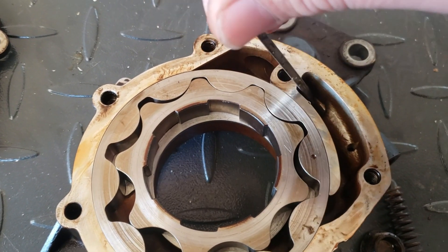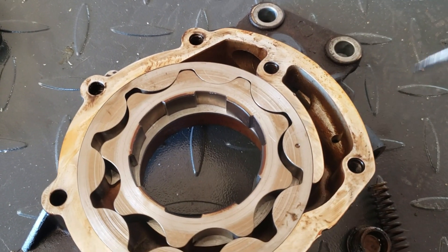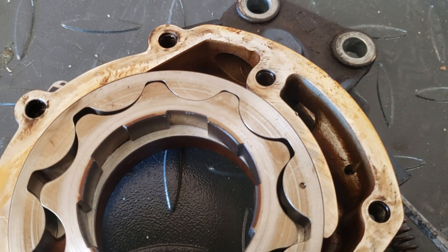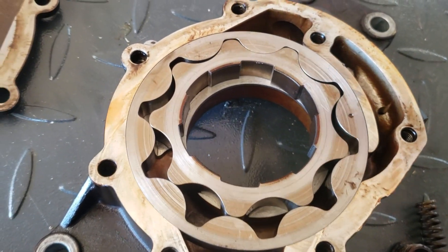So I don't think the pump itself actually failed — I think that plunger failed. But by the time I got down this far I wasn't going to try to clean this up and reuse it. A new oil pump was around $200. In fact, there it is now — I'm having to push kind of hard to get it to close. But I think that's what happened with mine. Caused my oil pressure failure.